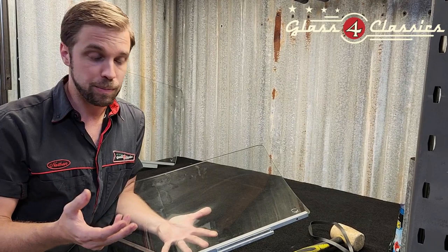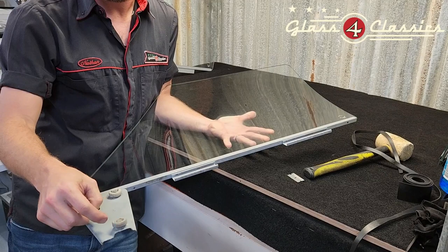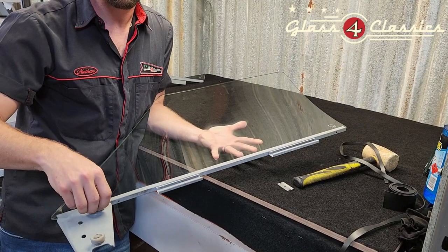Before — or once — these are back in the car, you need to lubricate them. Make sure you're using just some normal bearing grease that you use for trailer hubs. You want to lubricate in this C-channel, but also importantly these wheels. These ones are spinning nice and freely. If these are seized, which is quite common, free them up before you put them in the vehicle. Because once it's in that guide track, it is almost impossible to get them to spin freely again. So plenty of actual bearing grease in there — lather it up. It will make for a nice smooth operation.